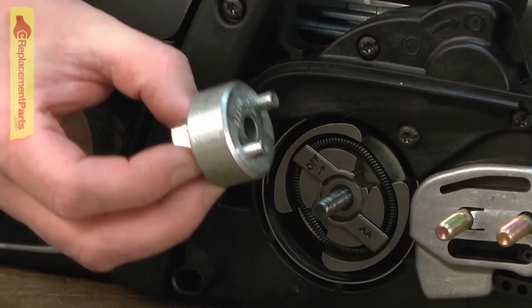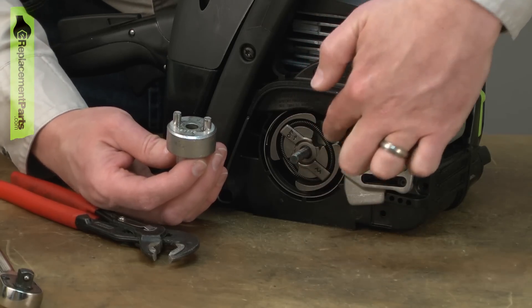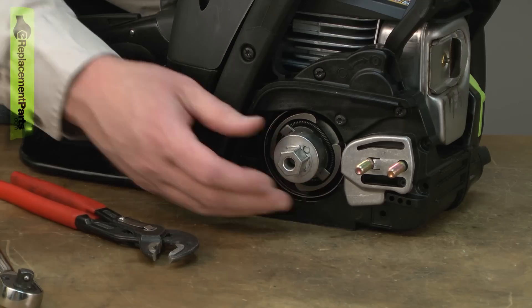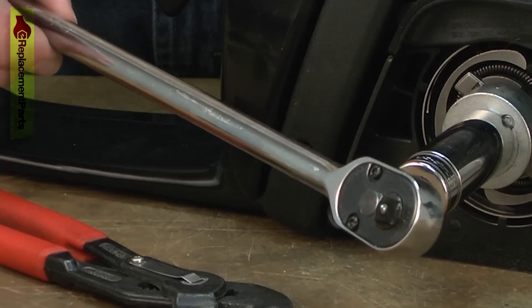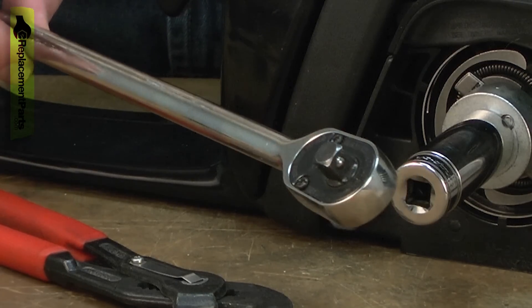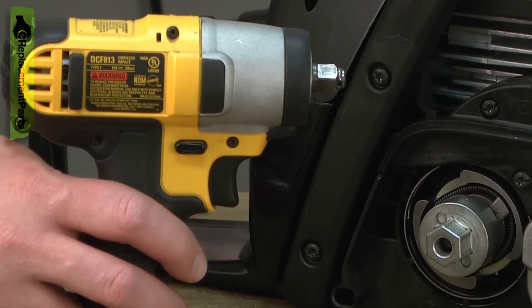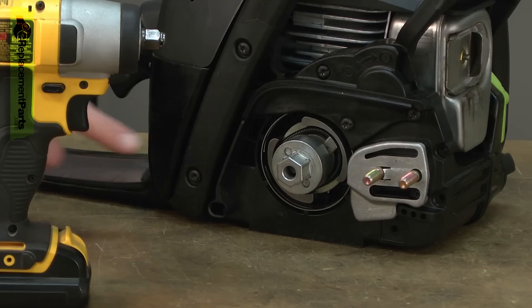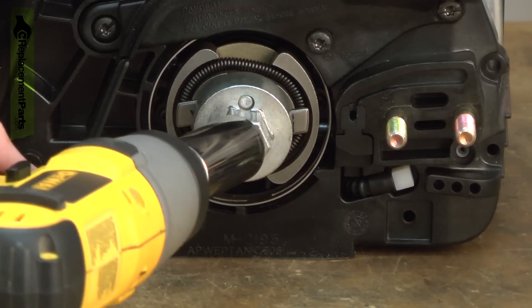The better method is to use a clutch removal tool. There's a couple of pins that line up with tabs on the clutch. You place the tool over the shaft and then place a socket onto the tool and use a ratchet wrench to remove it. Again, you'll need to bind the cylinder if you use this, or I think the better way is to use an impact wrench if you have one. With the impact wrench, the compression inside the cylinder will be great enough that you don't need to bind up the piston — the compression will keep the engine from turning over.